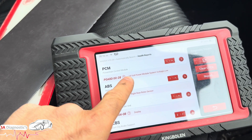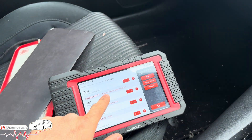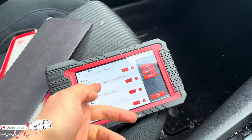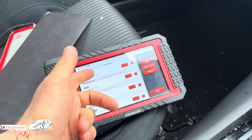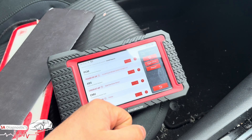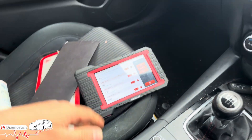The one fault that will cause it would be this one. The reality is it's your main battery that's probably drained and it's not charging up. I'd first of all check the wiring to the alternator and onto the battery, make sure it's tight. And if it is, then what I would recommend is changing the battery itself.